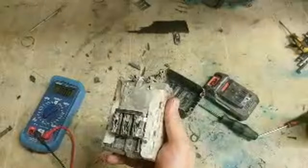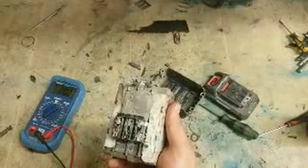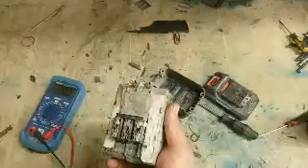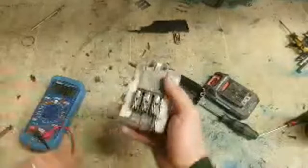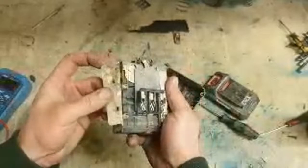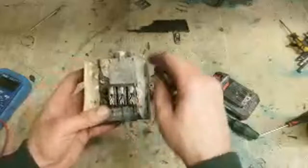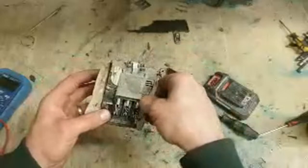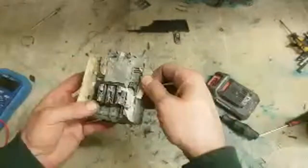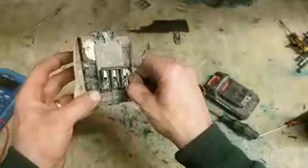Right, there's water damage in this too. With the Bosch 12 volt, if the hammer's not coming on, same thing. The grease has probably worn away off the piston. Try to open her up a wee bit and see if you can get a bit of grease into the hammer section. See if that helps it. If not, you'll have to do a strip down and change out either the piston, or hopefully maybe just the O-ring and the grease.